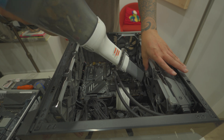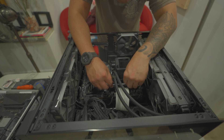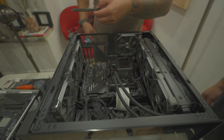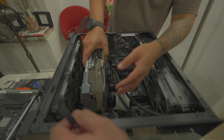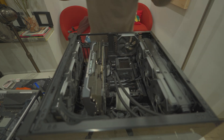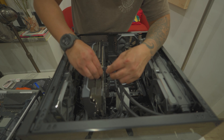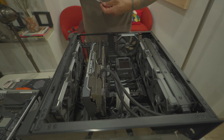A little cleaning — vacuuming the vents and the fan. We're going to install our RAM. Make sure you put it in the correct slot. When you push down the RAM you hear that click — that way you know it's installed properly. Final roundup check for any loose connections, then putting back our massive video card. Make sure you remove the sticker on it and gently put it in — there's a click as well, just to make sure it's properly hooked up. Putting in the power supply for our GPU and finally securing it with the three bolts mounted in the PC case.